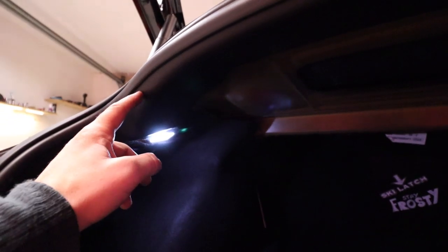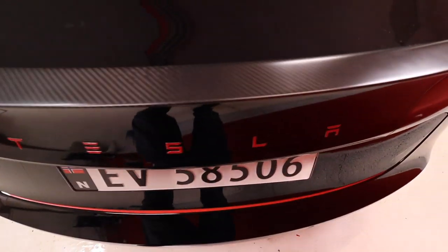After all, I just routed up all the wires, put them in there and mounted everything back together, just the same way as you took it out. There's a wire for the lights — I just put it up here behind this seal and over from that side to this one. They will turn on the light as long as your trunk is open. If you don't use them they will just blink because they don't get the signal from the other one. So that was easy. The foot sensor is working too.